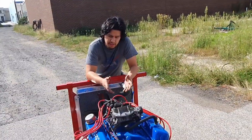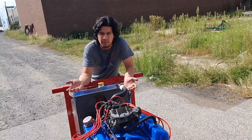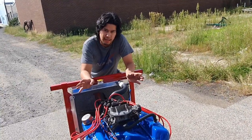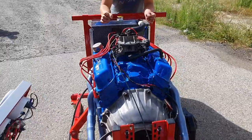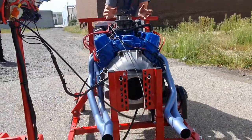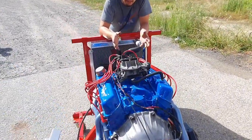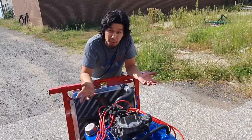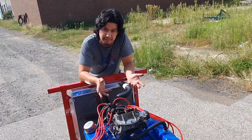Let's talk a little bit about motors. It's a 302 Windsor — we know we have Windsor and Cleveland. I'm not a Ford expert, but we do know that Clevelands have bigger heads, they breathe a lot easier, and thus they're the favourite. Here we have the 302 Windsor — it's a little baby motor. We think it's probably been taken care of in its past. When we opened up the sump, we didn't see any jelly-like oil, so I think the engine is going to be phenomenal.